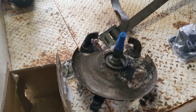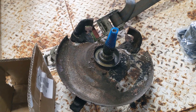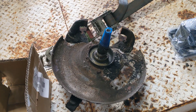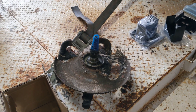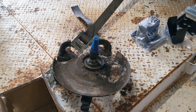Here are the old spindles — the original spindles that came off the vehicle. The replacement ones went on with no big issues. They were sold as a three-inch drop; I got about two and a half inches just measuring with the tape measure before and after, so that's pretty close. Once you get all the weight in the vehicle, it'll probably be right around three inches.